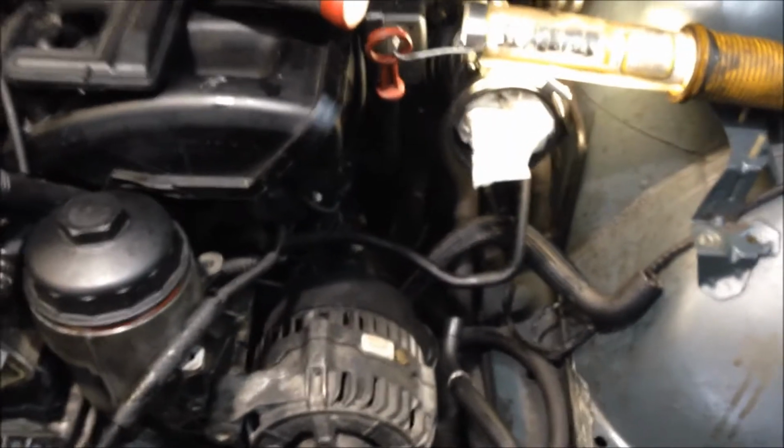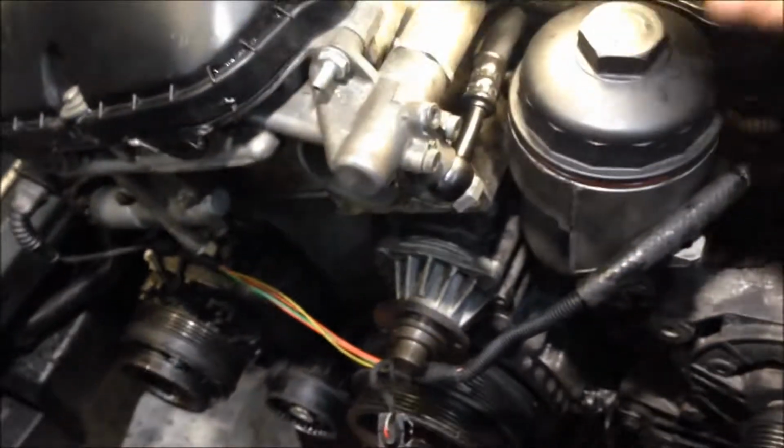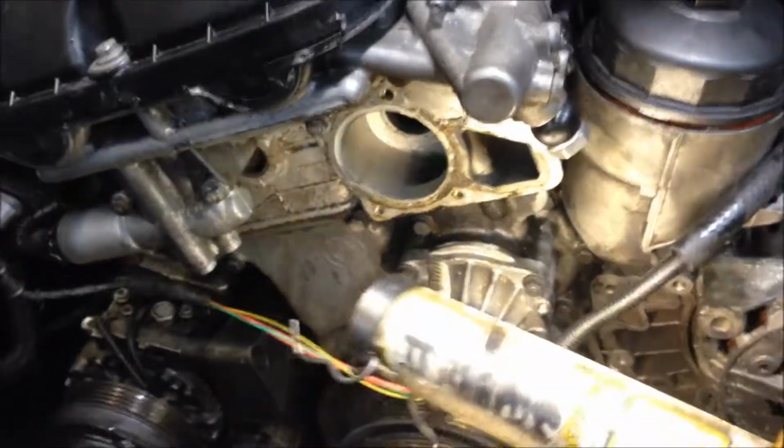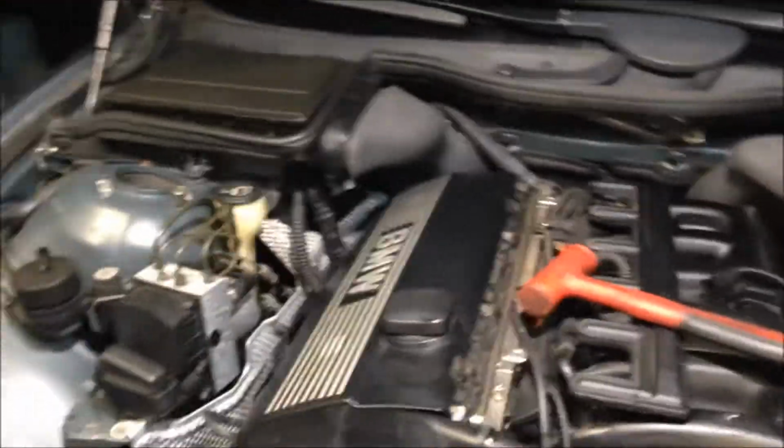I got the new power steering lines in. I made sure to face the clamp on it downward, so you can unscrew it if you're ever underneath the car to change it, because that's where you're going to be most likely. Another new line right here. I'll put this reservoir on tomorrow. And that's it. She's looking pretty good. Oh, new Vanos line too. This goes from here back to the other side of the oil filter housing. So tomorrow we'll do the thermostat housing, the water pump, then put it all back together, start it up.